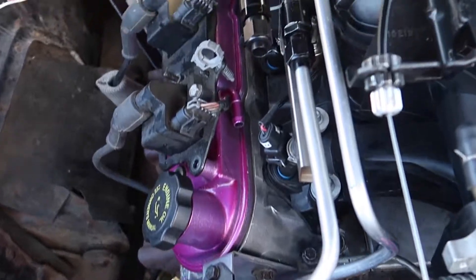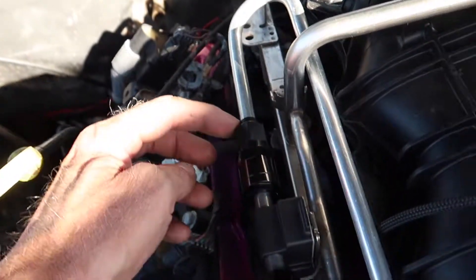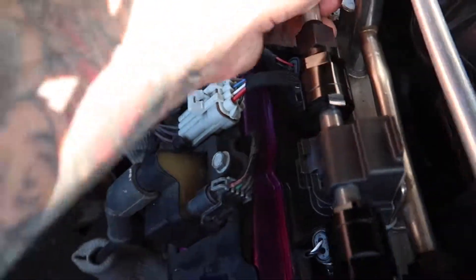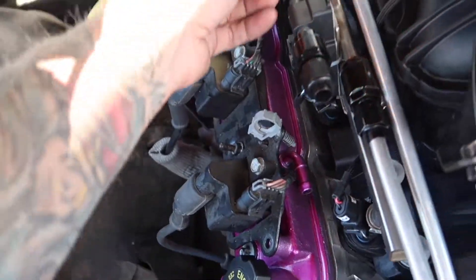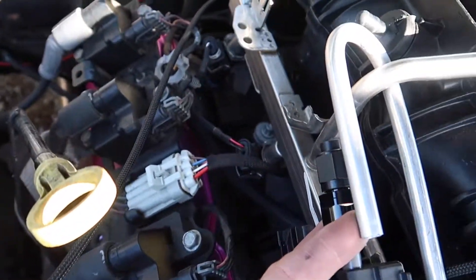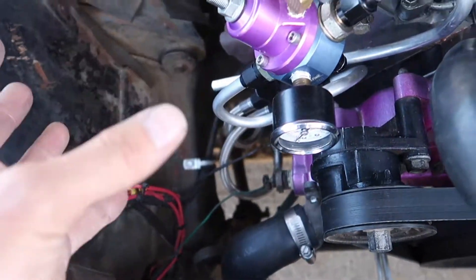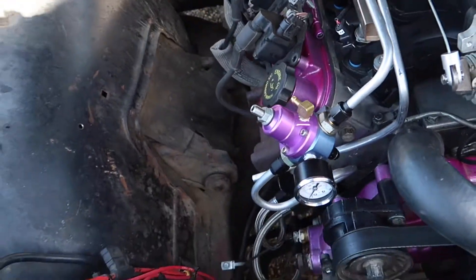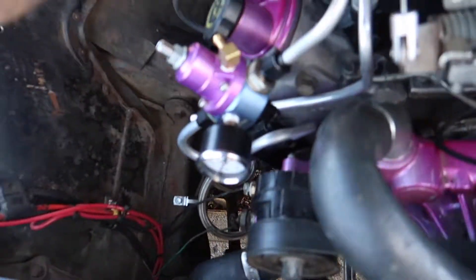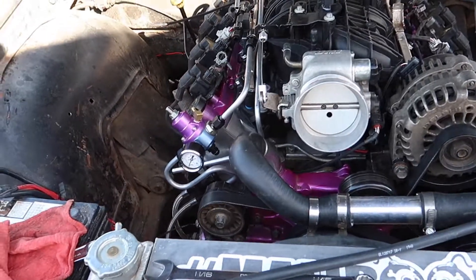Quick tip: this is a line I just bent up and made. You can put the fitting on and the collar as a nipple — it'll stick out. With the nipple in place, I can make my part and fit it exactly where it goes before I flare it or any of that. The flare will change the sizing a little bit, but not dramatically. That way I know it's what I want and where I want it. Then I can put my nuts and sleeves on and flare it, and that line will be done. Then we'll move on to the feed, which is on this side from the bottom — go down here and then up to that one, which should hopefully be easier, but you never know.